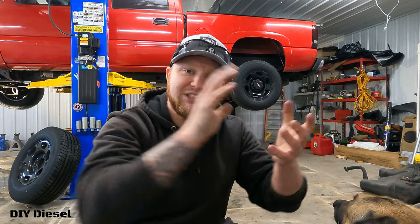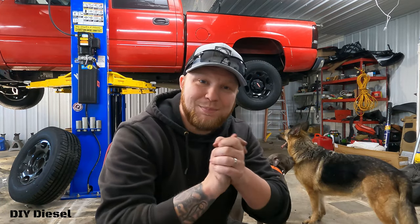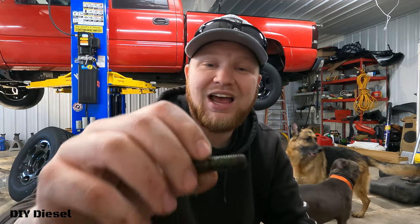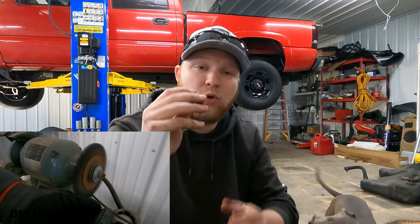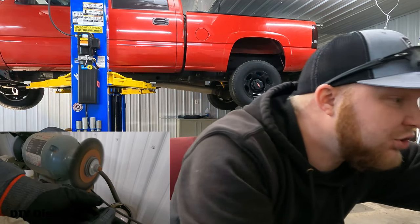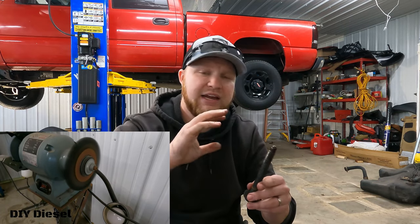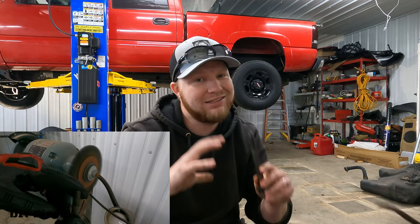You need to do that to turn your old steering gearbox in for your core charge, which is $150. We're going to show you the exact tool and how to properly use it in next week's video. For right now we're going to get the new pitman arm on the new steering gearbox. One important thing to mention: the set screw bolt you took off the steering shaft has Loctite on it. You need to take your old Loctite off with a wire wheel before you put new Loctite on and before you reuse a bolt. We're also going to clean up the old bolts from the old steering gearbox so the install goes easier. You can do this with a bench wire wheel, angle grinder wire wheel, or even just a wire brush.